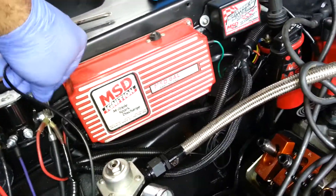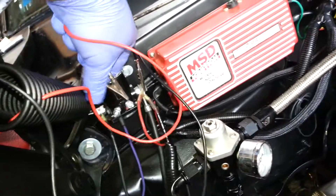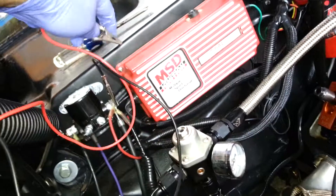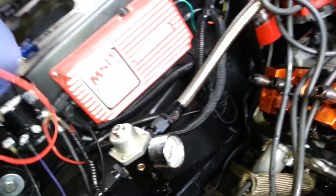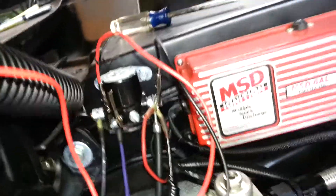It's just positive. The big thing is that you'll have to have a solenoid — this is the Ford truck style one. Summit and Jeg's sell them too for racing. You're just going to have to go to the battery side, put one clip on there, and then get your other clip and put it on the ignition side here. For this one in particular it's this little front one with the purple wire. You're going right on the other side and put it on there — it works the same. This just sends a signal through there to the starter.